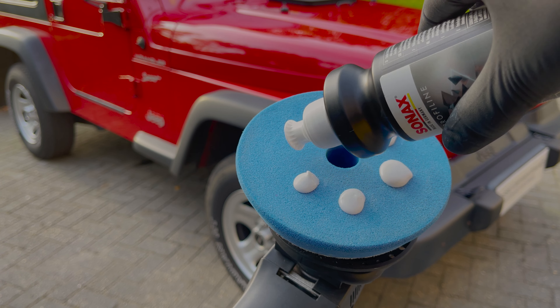Put on some gloves and you're ready to go. Put all your stuff within arm's reach for easy access. Because we're doing the hood first, we put everything we're going to need within reach on a foam rubber mat located in the center of the hood. You don't want to put your product straight on your car paint because that might scratch it. Take your large double action polisher with a coarse polishing pad and saturate it with six to eight pea-sized dots of coarse polish. You want to spread the polish evenly to saturate the entire pad surface with product, because a dry pad will cause marring.